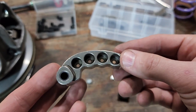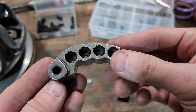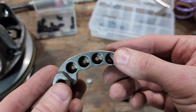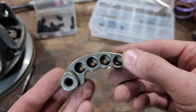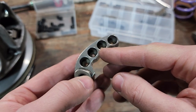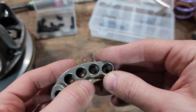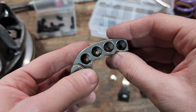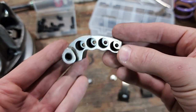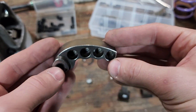On this weight there are four different slots where you can put the small adjustment weights, so you can actually adjust the tip weight. What I'm going to put in for weights and balance may not be the same for you — it almost definitely will not be. You can put more weights up at the tip for a heavier tip, or balance it differently. Since it's a turbo, a slightly heavier tip weight will probably help me, and I can always adjust this later.